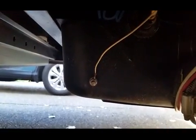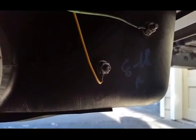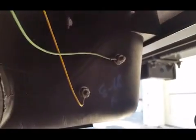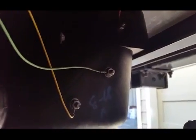So this is a black water tank. This is one of the connections here. This is the single one, and then it goes here. There's a 1/3, 2/3, 3/3. So when the fluid gets up to, let's say, this 1/3 level, wire connects, and the probe sends a signal to this, and it says, hey, I'm 1/3. When it hits this one, same thing, 2/3, 3/3, connects to that. So these probes, if they get buildup on them, or they fail, which they do, then there'll be problems.